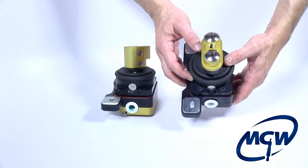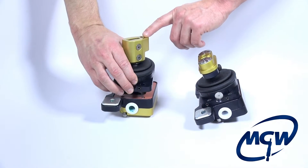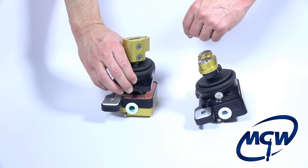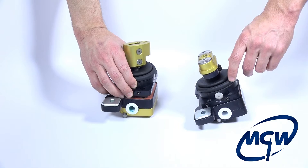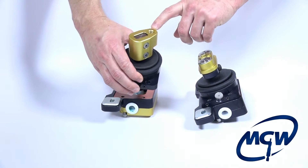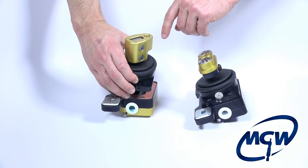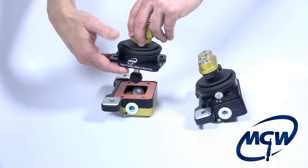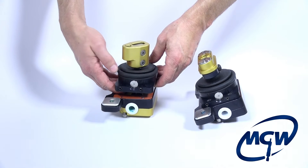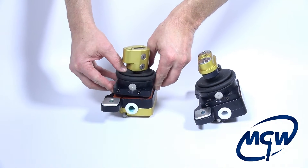This is our older design from last year and there really was no mechanical change. We just did a design change to the upper isolator so that the smaller version can fit better under the boot. The C7 boot is a little smaller than the C5 and C6. We also, due to customer demand, went back to the offset design. This allows you to put the shifter at the seven o'clock position if you want to get better reach, but some guys that have long arms actually want the shifter farther away from them, so you can rotate it 180 degrees and have the shifter over to like the one to two o'clock position and it bolts to the lower box the same way.